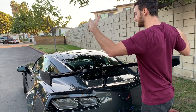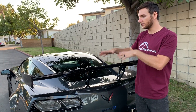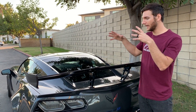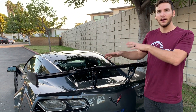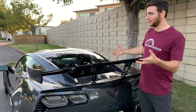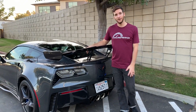Chevy developed it to be this specific width, this specific depth, the shape of it, and the position of it offset off the back of the vehicle — such that it develops downforce without creating additional drag. It is doing the most efficient job of managing that airflow, making it useful for the vehicle. And that, my friends, is the functional bit of aerodynamics on the ZR1 with the ZTK track package. All that to say, you may still feel like you couldn't be taken seriously driving this car with a bigger wing — that's a fair point. If you feel that way, Chevy will sell you a version of the ZR1 with the lower wing so you can feel confident with yourself.